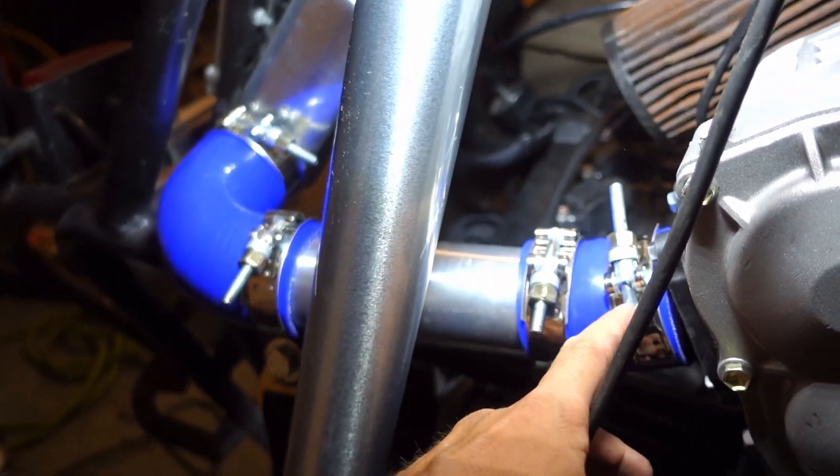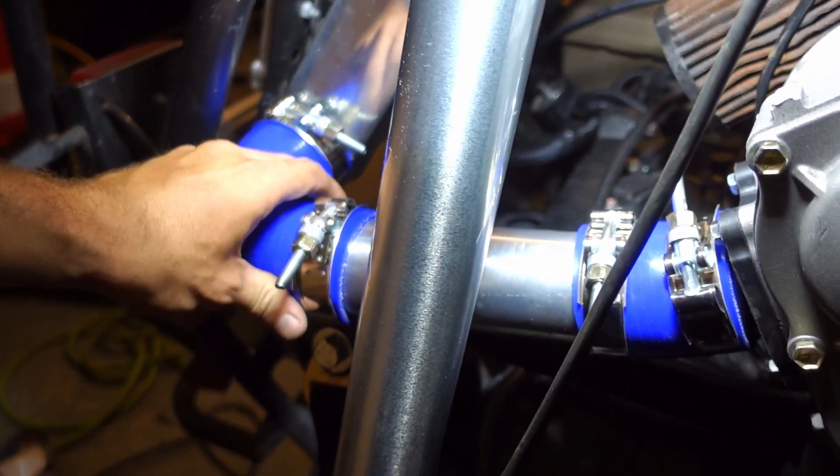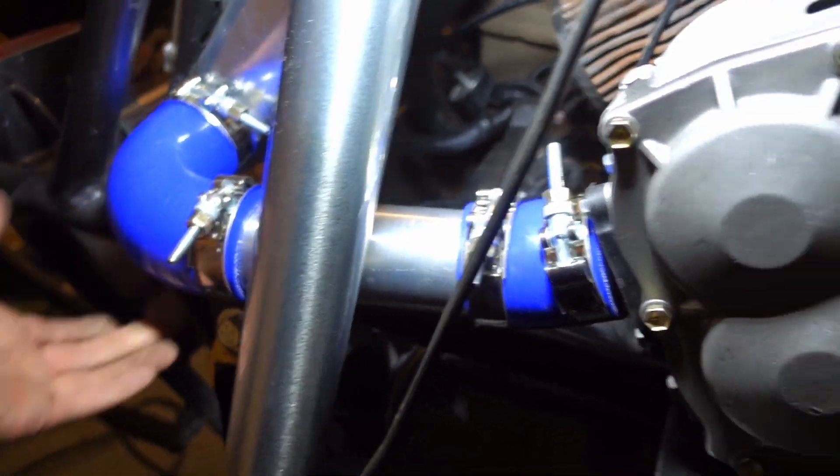The intercooler is not permanently mounted. It shoots across, comes down, under and through our suspension, down across, and then way back there tucks into the intake. I think it's a fairly airtight system. Clamps are all on. I tested everything basically back to this clamp, and everything from here moving forward was sealed really well, so it should create some boost.